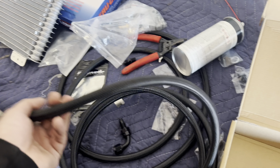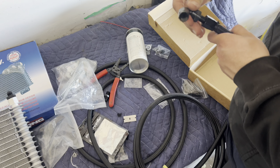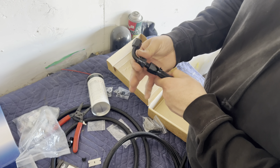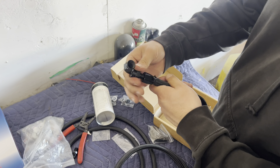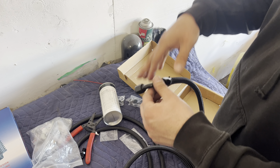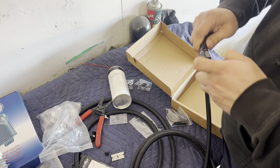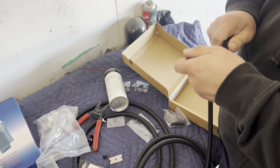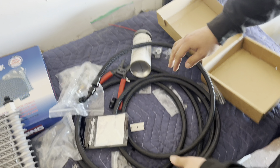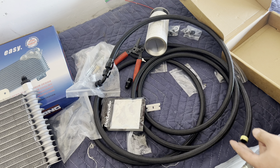Be prepared guys, use all your muscles — this guy is yoked and he struggled. Once this is on, you're gonna put this side in here and thread it — that's gonna go into the hose inside. You're gonna have to use AN pliers if you have them, or channel locks — just make sure it's not pushing the hose out and start threading. We're gonna do the other side so we have both ends done and then cut what we need.